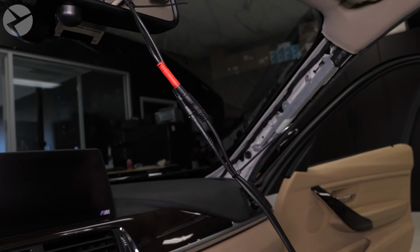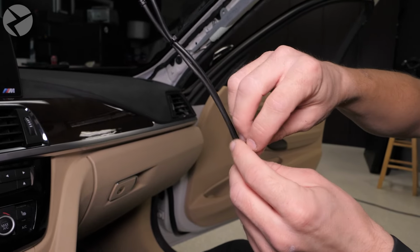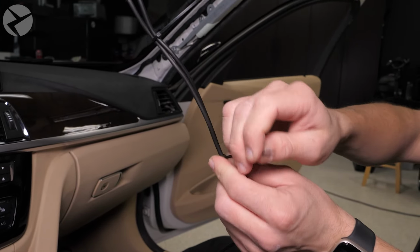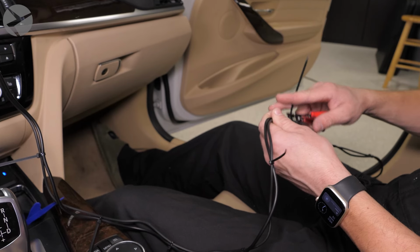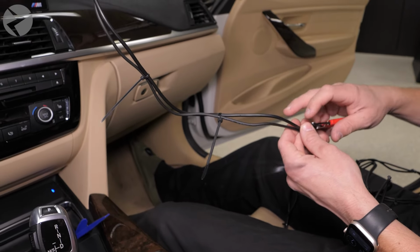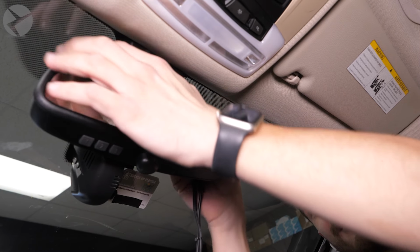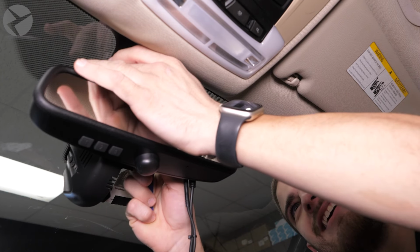At even intervals, secure the two cables with a cable tie. Don't go the full length, just do about half. Make sure you clip off all the tails with flush cuts. With the loom complete, take the cables and push them up carefully under the headliner with your hands and a trim tool.